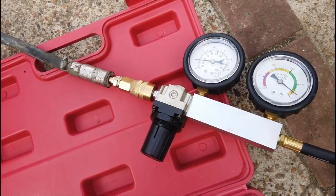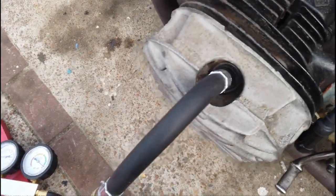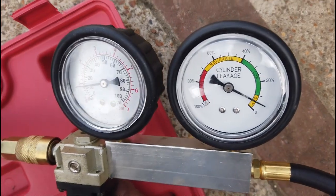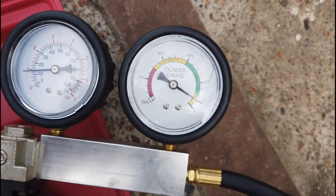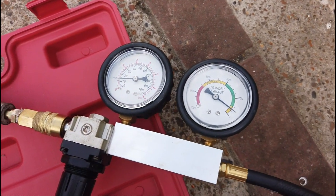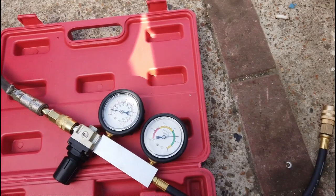Connect it up to the cylinder — it's at about 130 psi now. It should read on the right-hand gauge what leakage you're getting. You really don't want more than 20 percent leakage. On this one I'm getting about 5 percent at roughly 105 psi. To me, that is a really good system — there are no leaks and I can't hear any leaks at all.